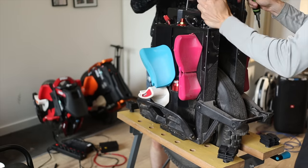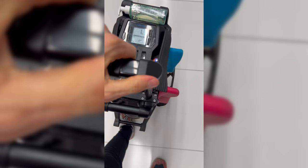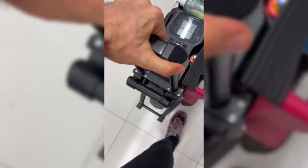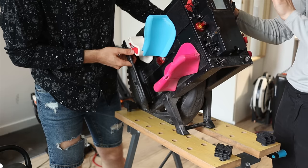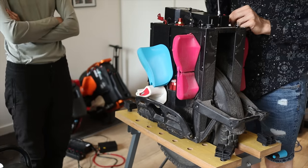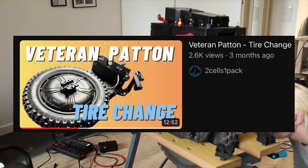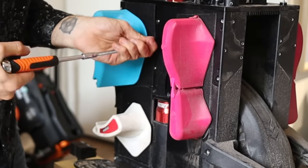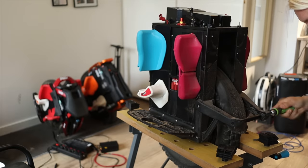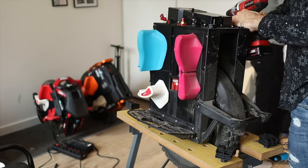Now we'll be removing the trolley handle, which is in the back and is a very usable trolley handle. However, this still feels so cheap — can you please make it out of metal? Just in case, since we disconnected the batteries, we also turn on the wheel for a second to make sure that the capacitors are discharged. By the way, if you just want to change the tire on the Veteran Patton, make sure you check out 2 Cells 1 Pack as they made a great video about the tire change on this wheel. Now we are removing a further 8 screws per side which hold the suspension pistons connected to the shell of the wheel. They were holding nicely and tightly. If you want to make sure they never get loose, put on some blue thread locker on them.